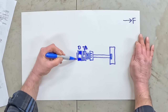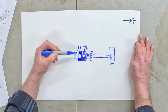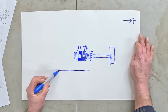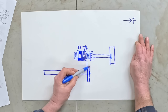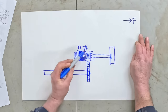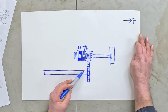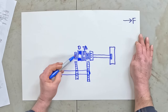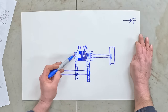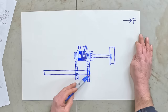Connected to the direct drive clutch pack is the quill gear. Down on the counter shaft, there's a gear that meshes with the TA gear - when the TA clutch pack is engaged, that gear powers the counter shaft. Connected to the direct drive clutch pack is the direct drive gear on the counter shaft. When that clutch pack is engaged, this gear does the driving while the other gear freewheels. It's either one gear or the other driving the counter shaft, depending on whether you're in direct drive or TA mode.